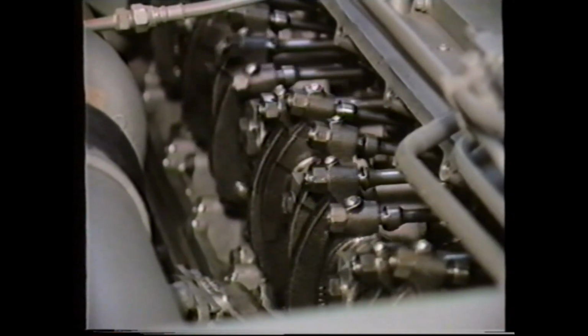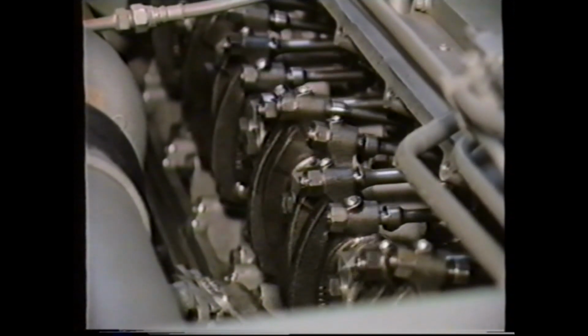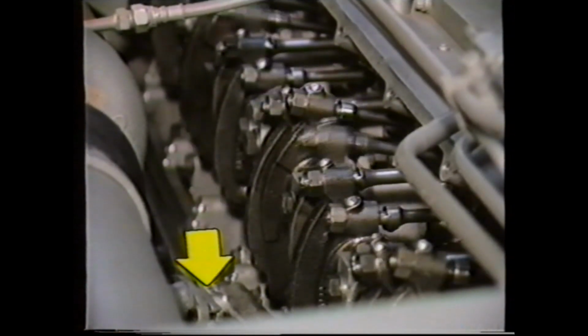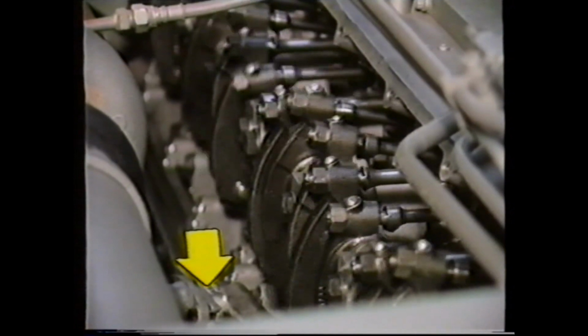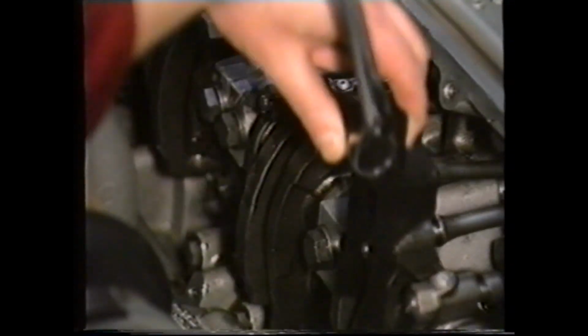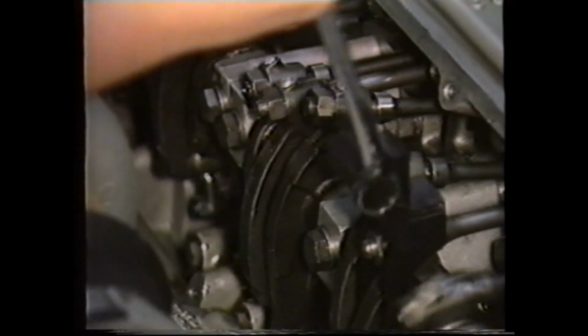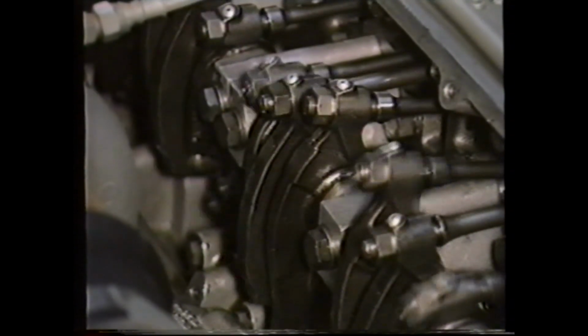You will notice in this example we have used a horizontal engine. However, be aware that the turbocharger oil drain pipe has been temporarily extended to carry the return oil back to the engine during this running test. If the problem still persists, there is either an error in the setting of the throttle leakage screw or a fault within the fuel pump.